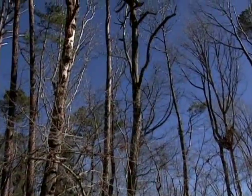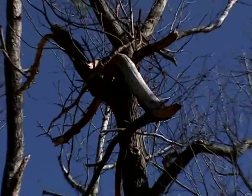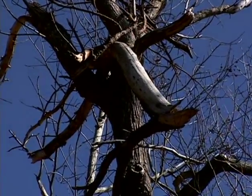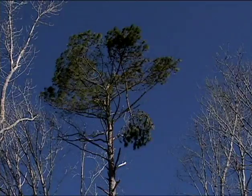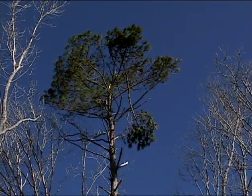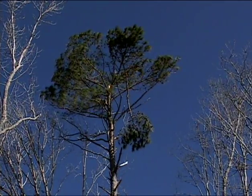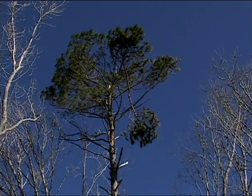Look for limbs and snags that may be located in the tops of trees in the area you're working in, referred to as widowmakers by professional loggers. Cutting wood with a chainsaw produces vibrations in the wood that can be just enough vibration to release a snagged limb. Disregarding this precaution and being struck by falling limbs has injured many chainsaw operators, both seriously and fatally.